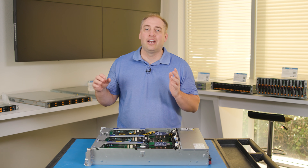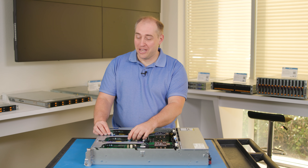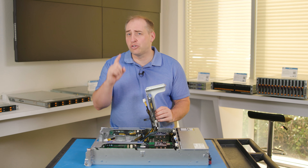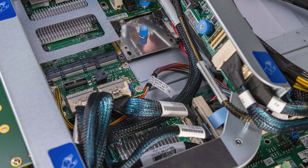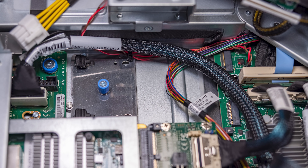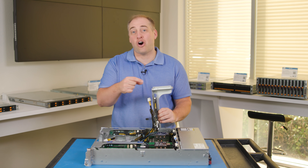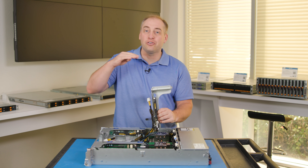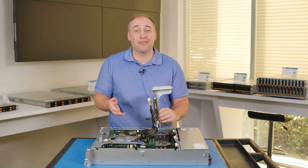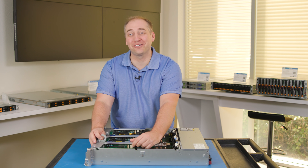There was one feature I mentioned that we really haven't seen with Supermicro previously. You can actually take out the middle riser, and what's below it may not be obvious — Supermicro actually has M.2 slots there. You can put SSDs in those M.2 slots, but the SSDs don't actually go on the motherboard itself. Instead, there are these little spring-loaded retention mechanisms where you hang the M.2 SSD off the side of the motherboard out towards the front of the chassis. Because you don't have the motherboard below it, you can do it in a thinner profile and fit the entire stack of components. You get up to two M.2 slots, and they're really cool in how they're implemented.